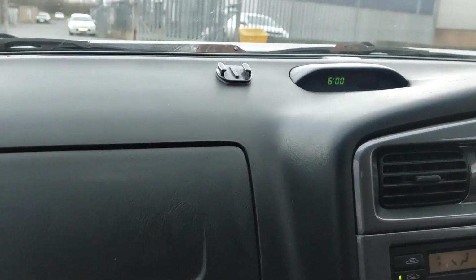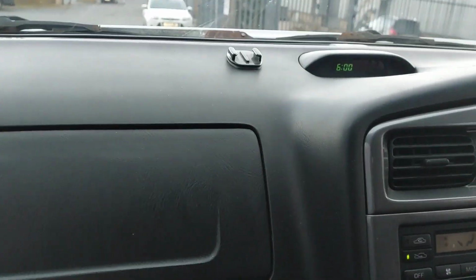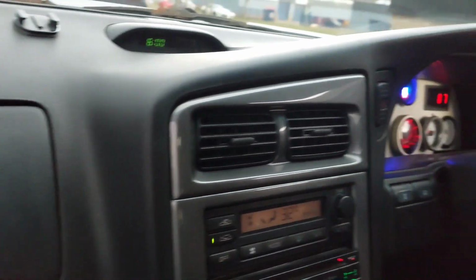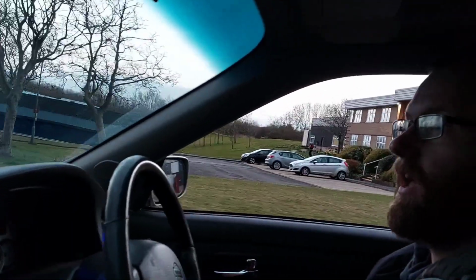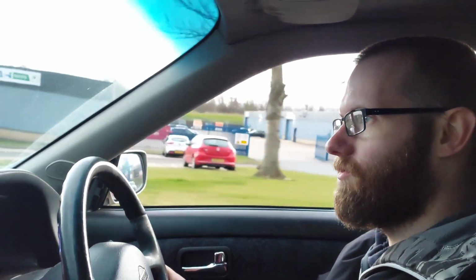So I think you were saying at the moment this thing's topping out at 130 miles an hour? Top speed, yeah. Private road, obviously. And the diff ratio, because I haven't got a clue how diff ratios work, I'm not really mechanically minded. I think you were saying, is this 4 to 1? These are about 3.9, it's the closest I could get. From the Nissan variant of differentials, out of an S13. So it's about 3.9 to 1. It's also the weakest link of the drivetrain. So it doesn't give you very good cruising speeds.